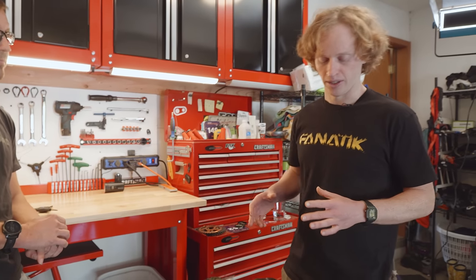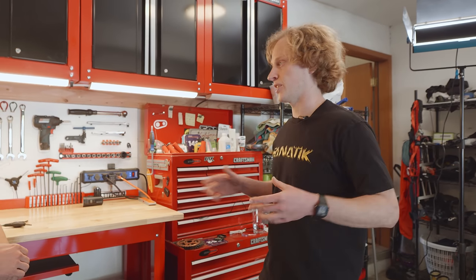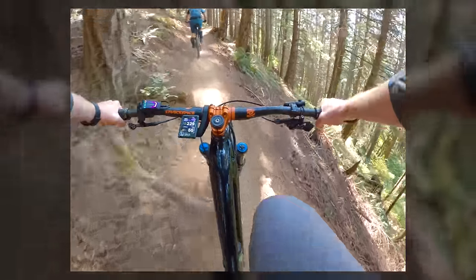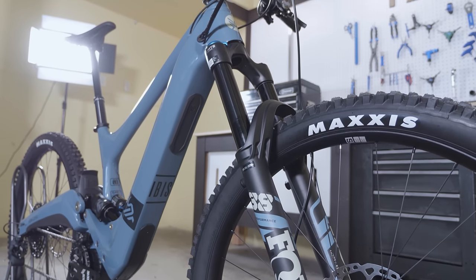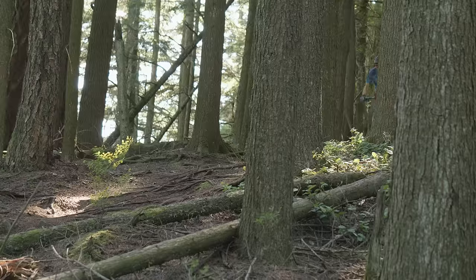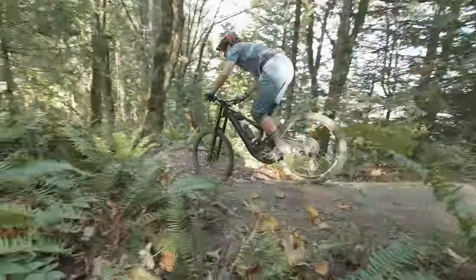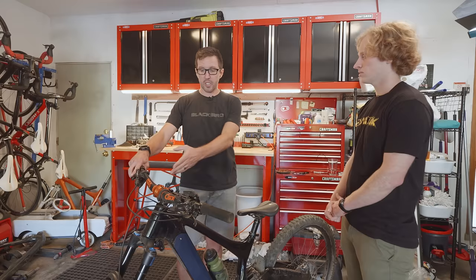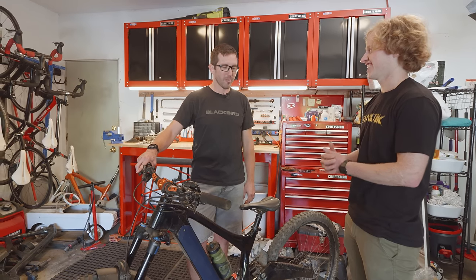Keeping the same feel between the Oso and IBIS's other bikes extends to things like stack height, front center, rear center ratios, and everything. So if you've been on an IBIS for a long time, you can hop on one of these and feel right at home. We steepen the seat angle quite a bit, and to keep the same top tube length means the reach grows — so there's no reason for anybody to upsize on one of these. We changed everything around to adapt: seat angle, the stack, chainstay length. So even though it's really long, it keeps the front wheel activated — you're never like, oh God, it's a boat. It feels good and quite intuitive, just like a heavier bike. 64-degree head angle, 78-degree seat angle — we decided on that three years ago and it's still fully modern now.